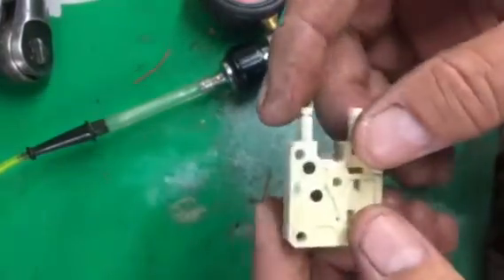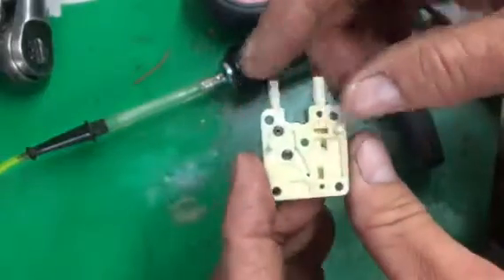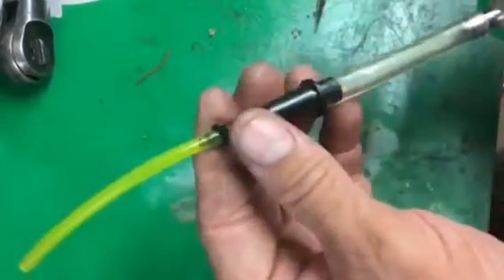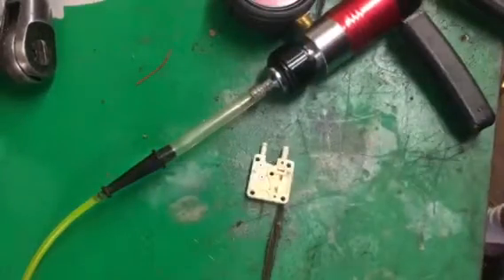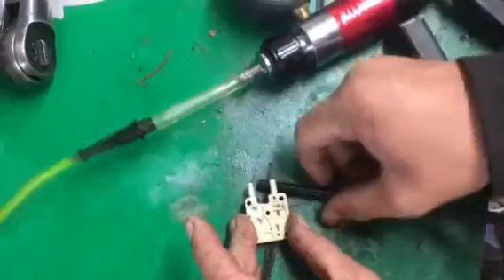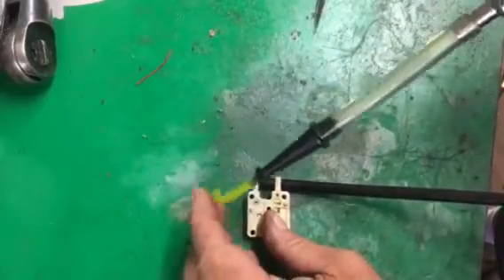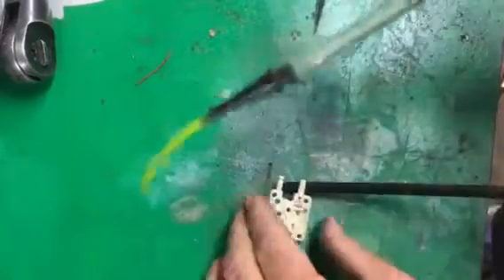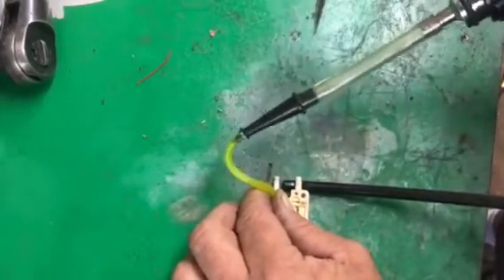First thing we're going to do — this is the primer bulb side — pressure goes through this thing through both check valves toward the primer bulb side. So first we're going to make sure pressure will go through both of these holes to make sure they're not stopped up. I've got my pressure vacuum tester stepped down to a piece of regular Tygon hose so I can put it up against these things. Put your stethoscope in your ears. I usually just hold one end of this down while listening for air coming out of the other spigot from this check valve. With this thing set to pressure, put it on there — you're going to need to hold it down really tight to seal off the air.